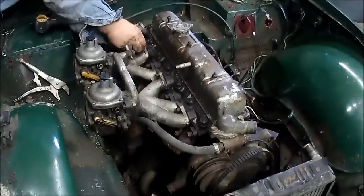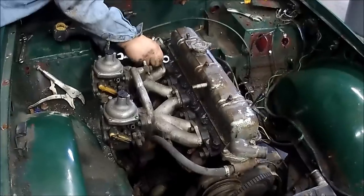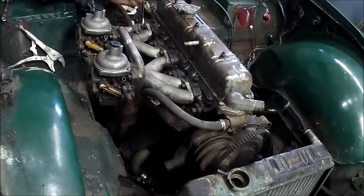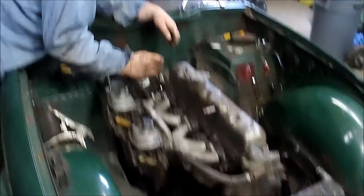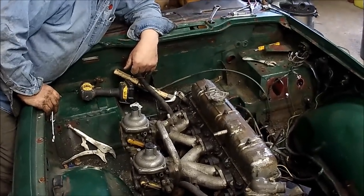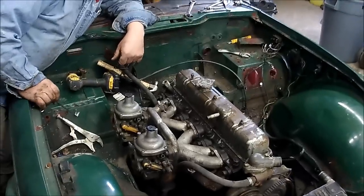Progress report: all the emissions hoses are off, the fuel line is off, all coolant lines are off. Les is just working on the intake manifold bolts at the top — we're going to leave the center one in, undo the two exterior ones, loosen off the center, and then go at the bolts underneath where the exhaust manifold and intake manifold meet — what I call the football connections. You can leave that stud like that because sometimes there's interference with the intake and the bolt until you actually pull it forward. Once loose from the head you can remove the nuts going into the head.